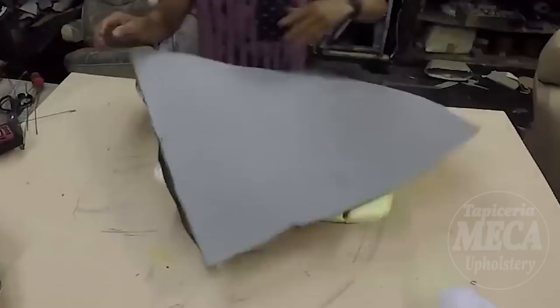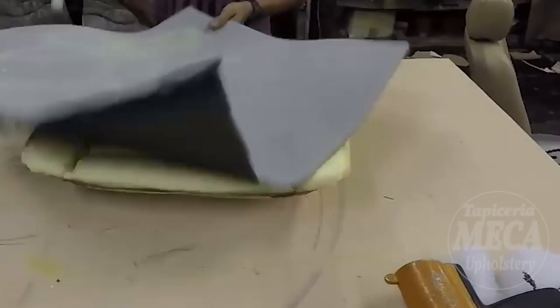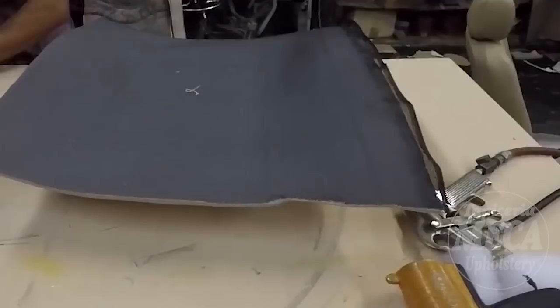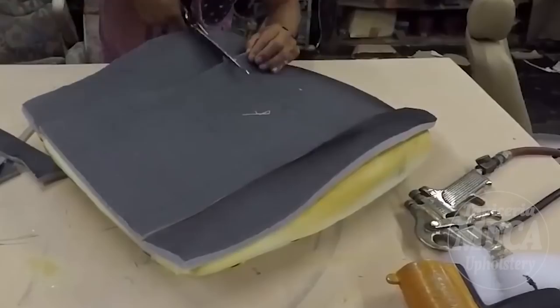And I am going to put this half inch on the top as a pattern. Always put a half inch on the bottom cushion, especially when you made the whole cover new. That way the customer can feel the difference. And right there, half inch on top. So you're going to cut around that. Okay, just going to make two cuts right there.